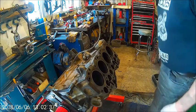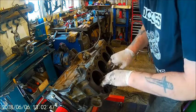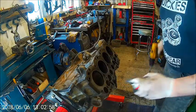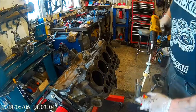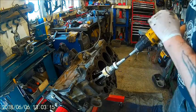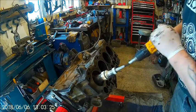Hello again everyone. Thought you might want to see this bit. The cylinders are in extremely good shape - I can't feel any ridges, and I've had a good look down and can't see any score marks or anything. So all I'm going to do is give them a quick hone, and what this does is just takes any imperfections off and helps create a few minor galleries for the oil to go in. So that's all it does, it's nothing drastic. Just takes any glaze off - you can see a bit of glaze down the bottom there.